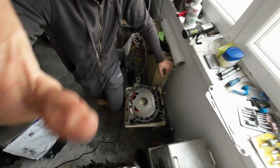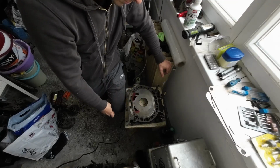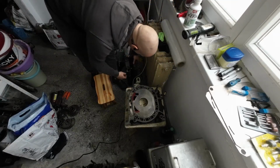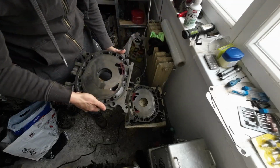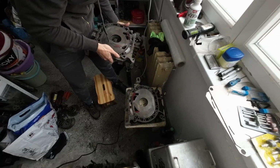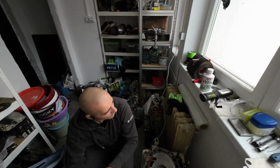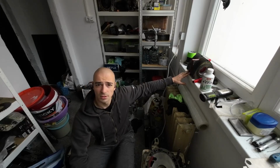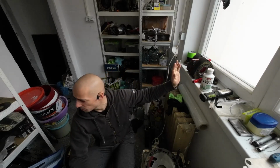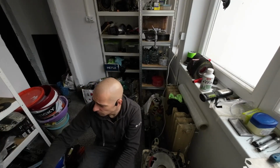I'm yet to port this rear iron because I have to take the pressure regulator out to put the template on. I do have a poorly ported Bridgeport front iron. I need to work on the exhaust a bit. Okay, they're all down here. I got balanced rotors. These are gonna be staying for the full Monty engine build. I have 2 housings here, 2 rotors, equal weights, pretty clean.